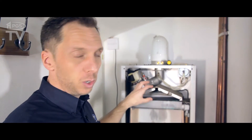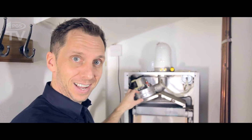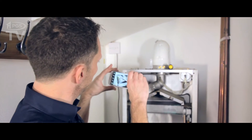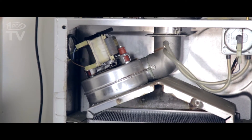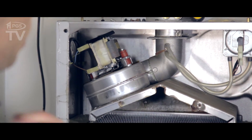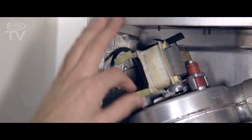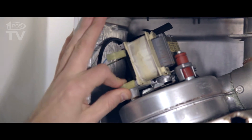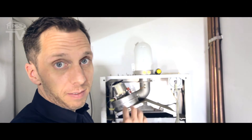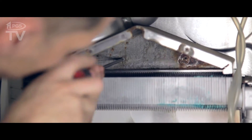I'm going to be taking the fan out and the fan hood. I like to take a picture of the wiring just in case I forget when I put it back together — the blue one's at the top, the brown one's at the bottom. I'm just going to take a quick picture. I also need to take these tubes off, so I'm just going to put a bit of tape around the top one so I'll remember which way the tubes go when putting it back together. I'm just going to loosen off the fan clamp, undo the screws on the hood, and then pull it out.